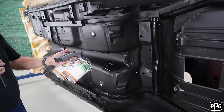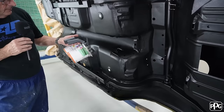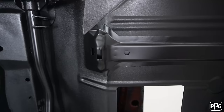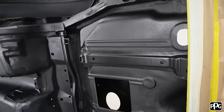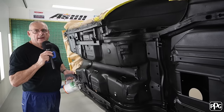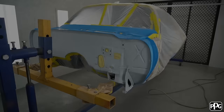So there's the result — two coats of satin clear. What I'm using is a combination of D8115 and D8117 mixed 50-50: a matte clear and a semi-gloss, and that gives me a satin. I really like that finish and have used it a lot. It'll dry out just a little more and go to that nice sheen that looks sort of factory. This clear coat is designed for the exterior of late model cars done in matte, so it's very hardy. Using it on the underside is probably a little expensive, but it will last a long time.